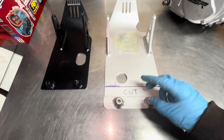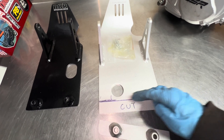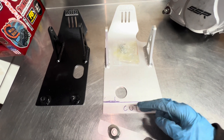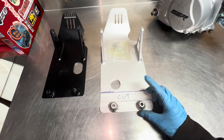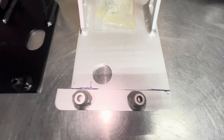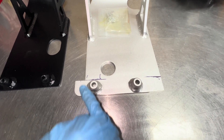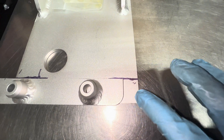The bolts for the YX engines are right up here, so bolt that on the bike and leave yourself a little bit extra — I drew the line right here. What you're going to want to do is cut it right there, then bolt it back on the bike. Swing this piece — obviously this will be cut a little bit longer so you have room to massage it in there — but what you'll end up doing is this piece will go forward and over and then it will bolt on. So once it's in that position it's perfect. What I did was I cut that end off, made sure I put lines, made it nice and even, weld that seam there, then cut that off and flip it and put it on this side and weld it on to the piece that's going to be missing right there.